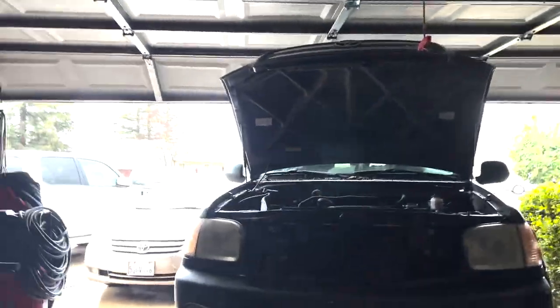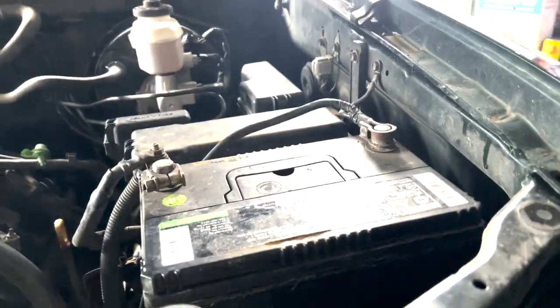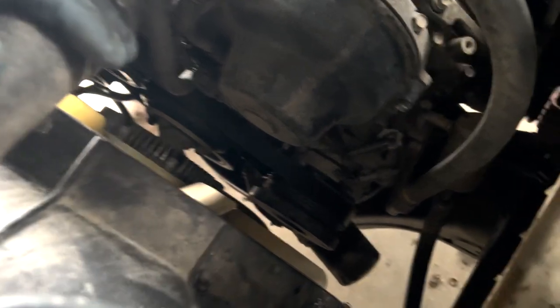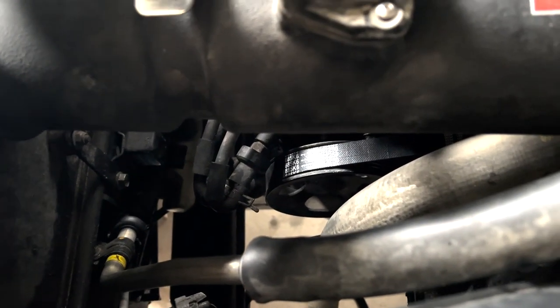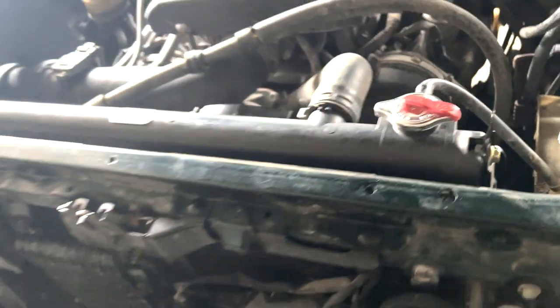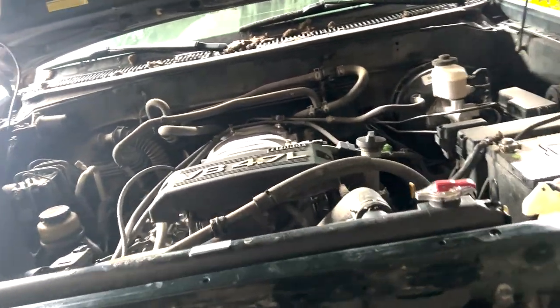Back here, just completed everything. Don't make that rookie mistake of leaving that connected and grounding out when you disconnect your alternator. Got a new serpentine belt on — a little bit challenging but just do the alternator last. Previously there was a Dayco brand belt on there; it's always a good idea to change it out when you're doing the alternator unless you know it's brand new. Let's start it up and see what happens — actually let me get the power steering hose clamps sorted first.